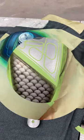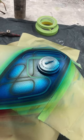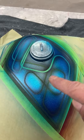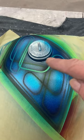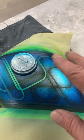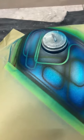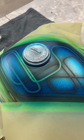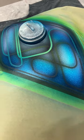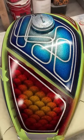I chose to do the endless line in a candy blue panel. What I did previously was fog around the endless line with a light tinted clear with black in it, and now I've fogged around that with candy blue. I'm going to leave some of the silver in the center so you'll really be able to see the metal flake once it's cleared. I'm going to fog the edge with either cobalt blue or maybe some purple — that should look pretty neat. The bike is actually supposed to be candy red, but he said do what I feel, and this is what I feel.